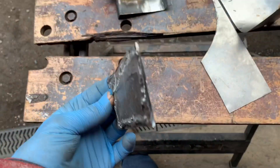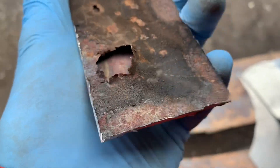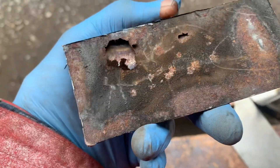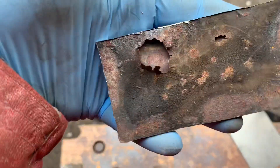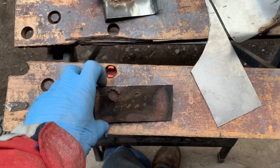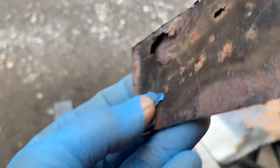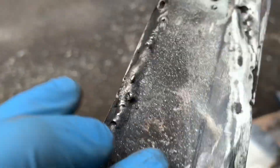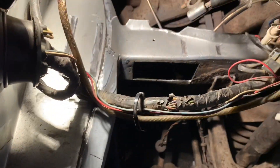In this particular case here, you can see this is actually a structural piece of steel — it's a thick piece — and what the person who repaired this has done is whacked a huge patch over these two holes here, hoping for the best. The problem is you can see quite easily that moisture and salt water can just get into that gap there, which is exactly what's happened, and over time that will just rust through the patch panel.